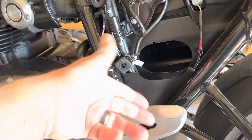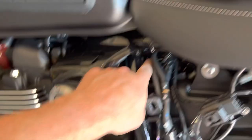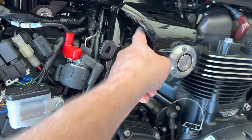That's okay to just let it vent, because if pressure builds up, you want it to be able to come out. The line that was over here — I moved it to the other side as I was tracing this — that line went back; that was the return line. What I figured out was that goes up under this cover. There's a line that goes up in here into a solenoid that can turn on and off and open a valve, and then it goes straight into the intake track.